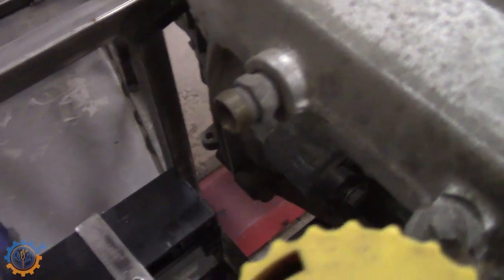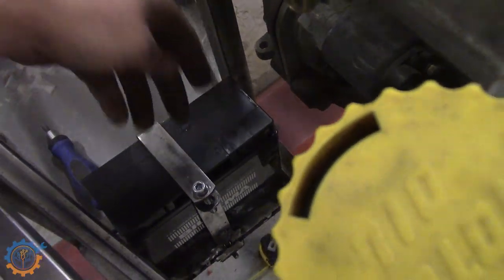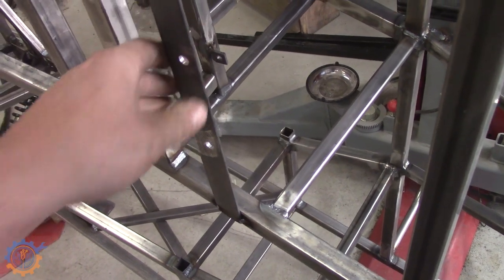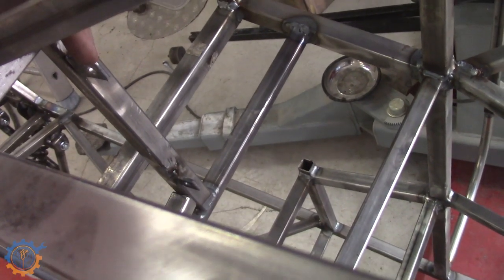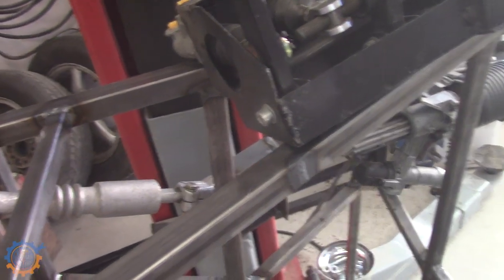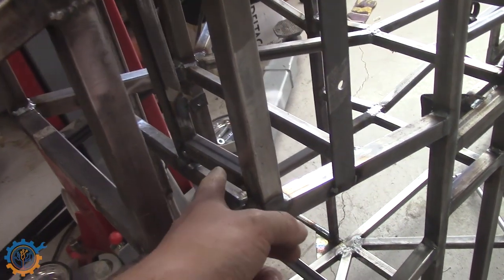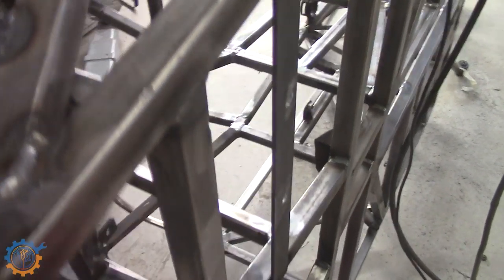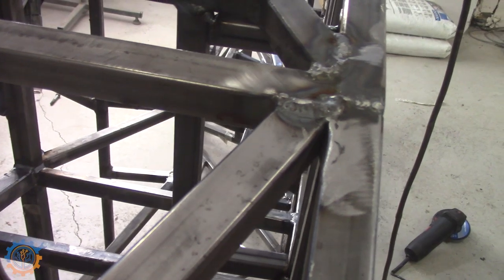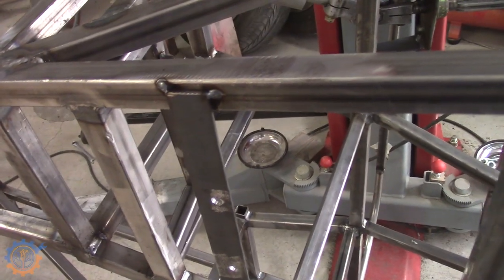The protection for the output is actually in here so we can use those original ones and they will be fine. I have also done a couple of modifications to the braking system. I added a plate underneath because I realized I only had M6 bolts holding it together at the top of the brake — that's plenty in terms of pressing since it was press fit into the box section. I also added a piece down there and an angle up here; those are to seal the area off, making it a little bit easier to get this area together. I will be welding this up and then I consider the pedals to be done.